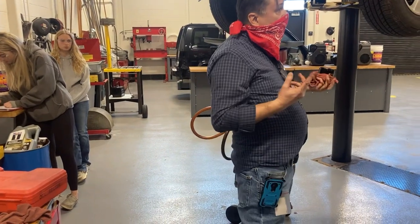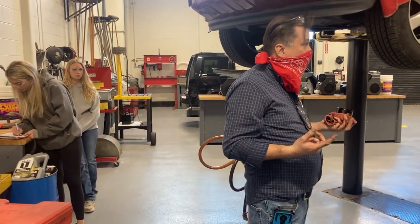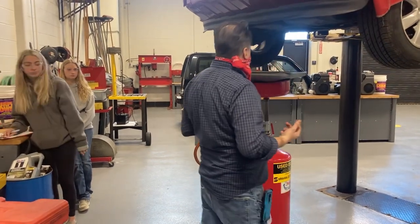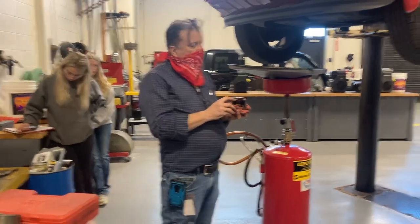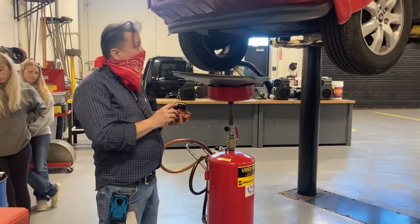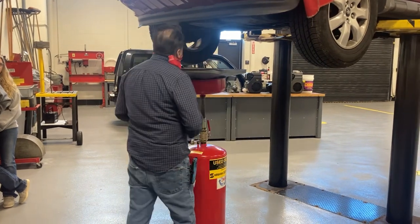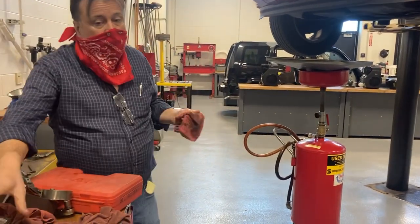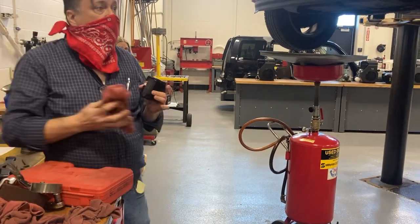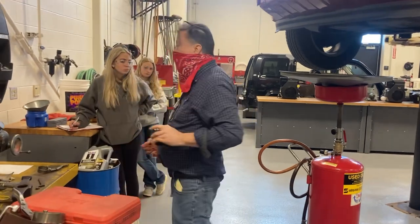Make sure that it doesn't stick to the engine block, especially on Fords. They love to do that, and then you double gasket and blow them up, and you get down the road on the line. So the square cut seal is on there. All right, and I'm going to look up at the engine block. It's good up there. This oil filter actually goes straight up. Mr. Tomosik talked to you about what you can do with an oil filter that goes straight up when you're putting it on. Put a little bit of oil in.